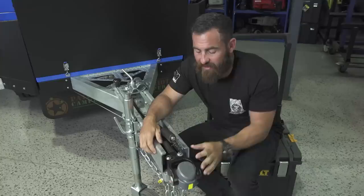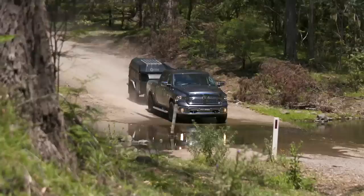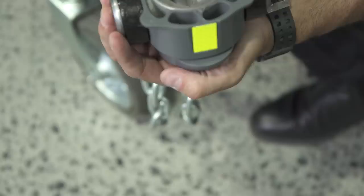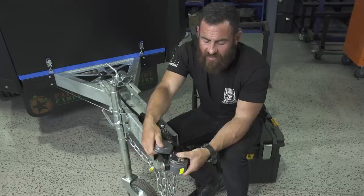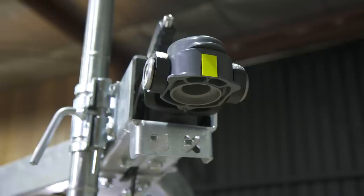With your 50mm ball, or even bigger balls, for safety reasons especially when you're off-road or doing high-speed stuff — once that ball's locked in, if you get into the situation where you swerve heavy and the trailer's going over, nine times out of ten you're going to go with it. That's probably the biggest thing about the DO35 — this fully articulating spindle. You can go 360 degrees in this direction, 180 degrees in this direction. If you're going past 90 degrees your trailer's going to be hitting the back of your car anyway, so that'll stop you. The fully articulating hitch is the main feature.